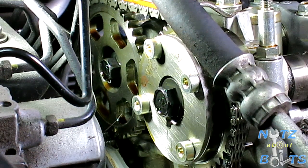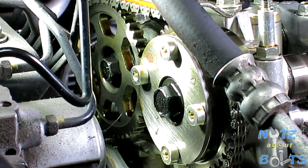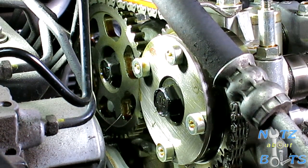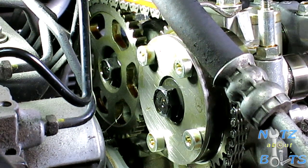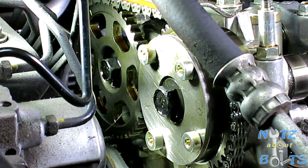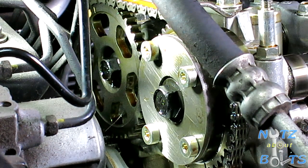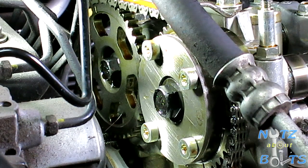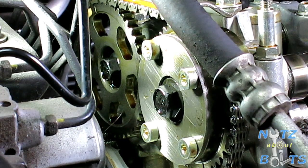All right, so now we're cranking the crankshaft another 90 degrees so we can get to where we can do an inspection of cylinder number 2. As you can see the arrow here, we're gonna want it, oh, a little bit more. And keep going. A little more. I think that's about it, right there. See the arrow? Yeah, so the arrow, if you're facing the engine, is gonna go directly to the left, and then you're in position to inspect the valve clearances on cylinder number 2.